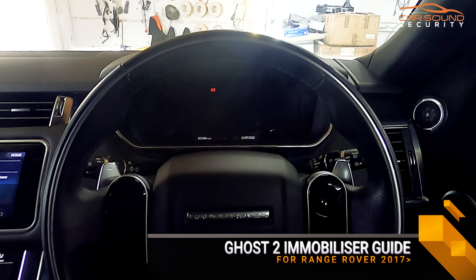Now I'm going to show you how to change your code. Do not press the brake, just press the start button only and you get your ignition come up. Now you enter your current code, which is one, two, three, four — it will be whatever code you set it to. You get the two flashes, and now what you want to do is — do not start the engine — you want to hold your high beams. This is your high beams, you pull this towards you, and you can see your high beams are flashing. While holding it, you now need to enter your code again.